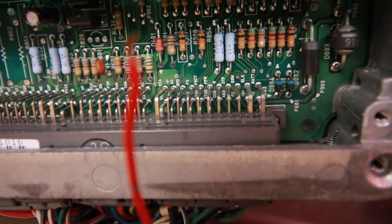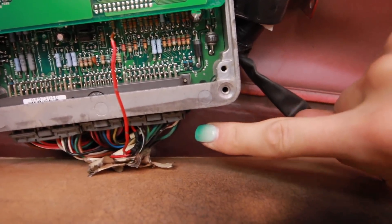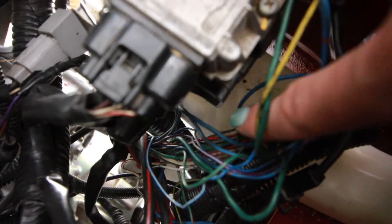There it is — FC, the third wire from the right on the last plug. According to the wiring schematic, that wire should go directly from the ECU to plug EA-1, which it is not doing. This blue wire with the yellow stripe from terminal FC — fuel cut — on the ECU goes down into the loom under the air box and we cannot find where it goes. We've connected it to a wire that provides a ground for the circuit opening relay and we're going to jump it to terminal FC in the ECU, because that's how it should be wired per the USDM MR2 wiring schematic.